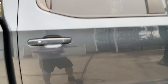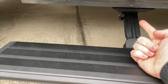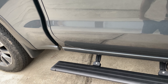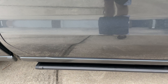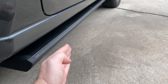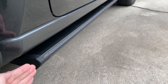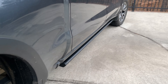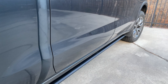The one thing I had to do on the passenger side was put some shims on the rear bracket where it bolts to the inside of the bottom of the truck. When the steps were in, they weren't folding in as far as I wanted — the rear end was sticking out quite a bit even though the front was sitting in well. One shim on each of those bolts actually pulled it in far enough to get the look I was going for. Now it's really straight along the bottom of the truck — in and looking real good.